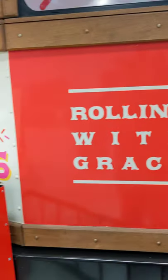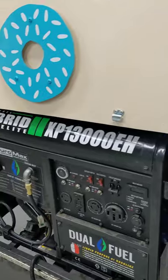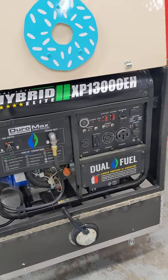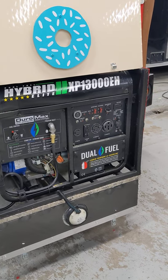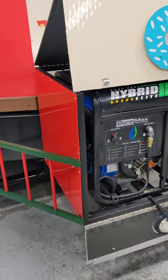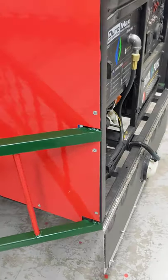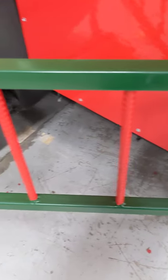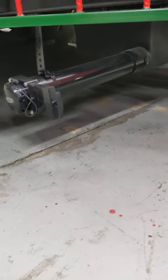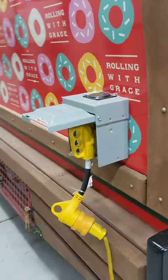We put the three-compartment sink and the hand-washing station in, and put the fill valve panel right there. They had this hybrid Duramax generator — it's a 13,000 — puts out somewhere around 9,800 watts. They wanted to mount it on the rear of the unit, so we fabricated a cage that mimics that of a caboose. We welded all the metal in place and used rebar as the dividers. We've got the gray water tank mounted up underneath — that's a big 45-gallon tank — and we put a 50-amp electrical box on the outside.